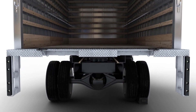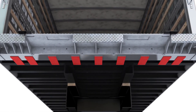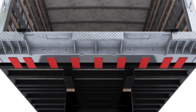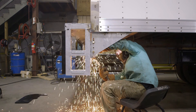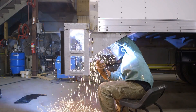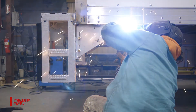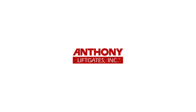To help strengthen the rear sill when a heavy load is placed on the floor extension, add several strengthening plates between the rear sill and the truck bed frame. These plates are not supplied with the liftgate. Finally, you can install and weld the side gussets using a continuous weld across the top and side of the plate. If this method does not work with your specific installation, other methods can be found in the installation manual. You can now continue to the next phase of the installation for your MTU GLR model liftgate.